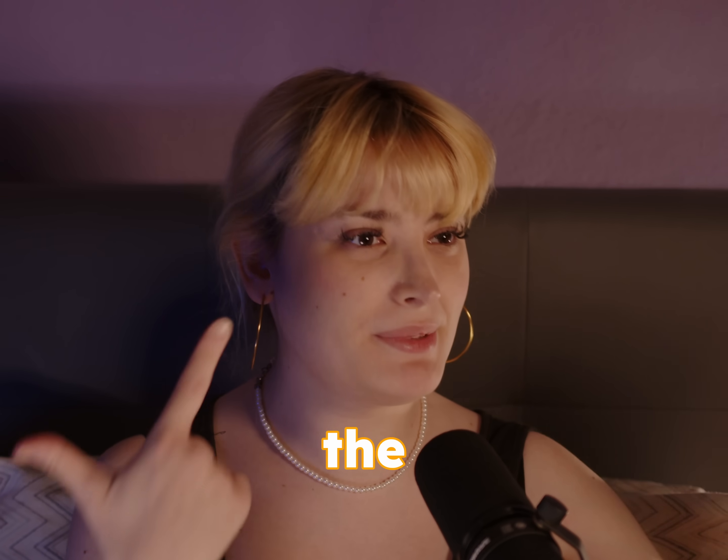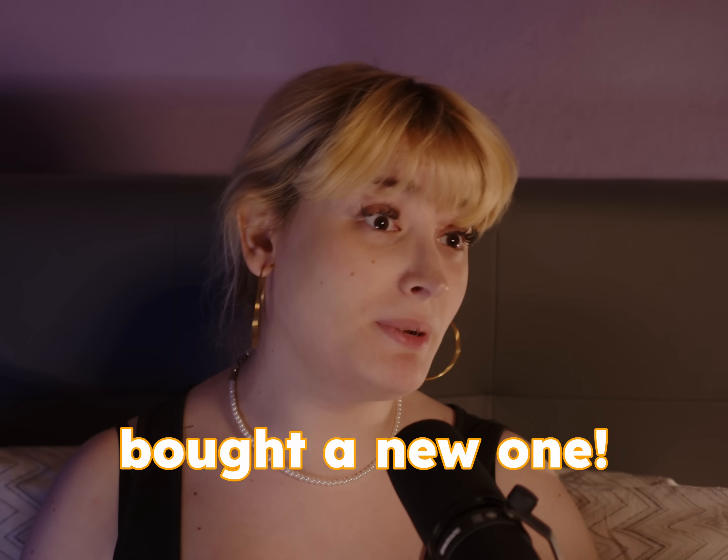It works! But every color is wrong. I might have been flying too close to the sun — maybe the chemistry between different printers is actually different, maybe the way it reacts with the paper is different. A clone says: even though you're the OG and I'm the clone, I was right — you should have bought a new one. But actually that was a test and you failed. It was a mistake on my own end — I did everything correctly. The only mistake I made was the way I spooled the ribbon: it was supposed to go this way and I put it this other way.